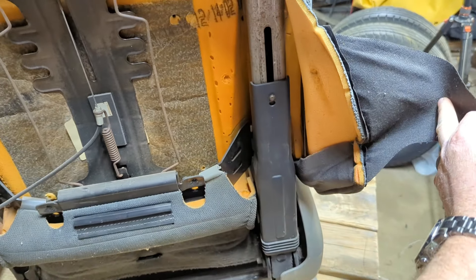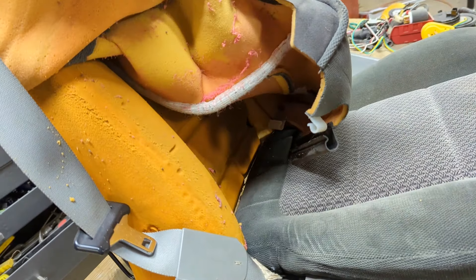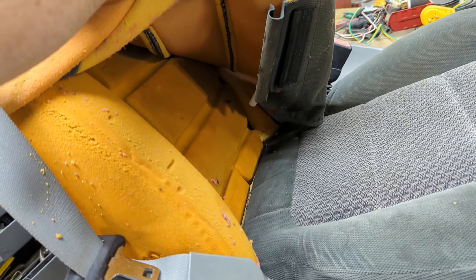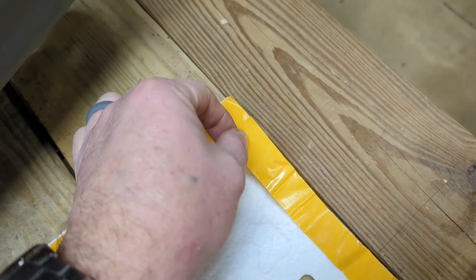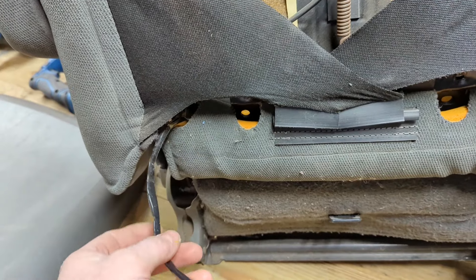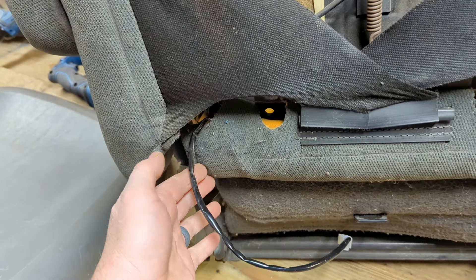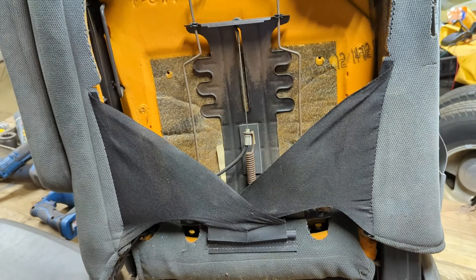Once the plastic back is off, there are little webbing things that you remove, making the upper part of the seat easy to access. They fold back and you can just unpeel the material, slip the pad up on the front, and put the material back together. I pull one corner away while keeping the other corner tucked in, slide the pad underneath, and stick it in place. The backside of the pads have a sticky material — basically two-way sticky tape. You peel the plastic off, stick it in place, then rework the fabric around the seat and reconnect all the clips. Run the power cable out the backside in a corner where it won't get pinched, then put the plastic cover back on.